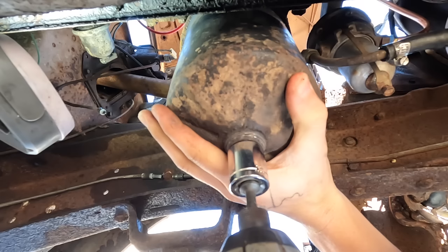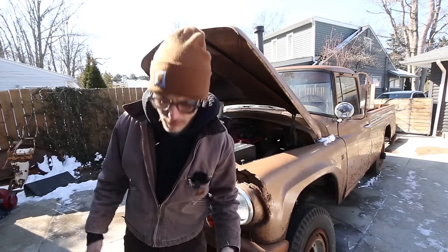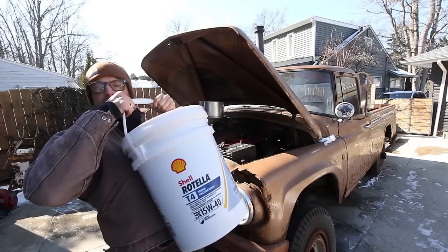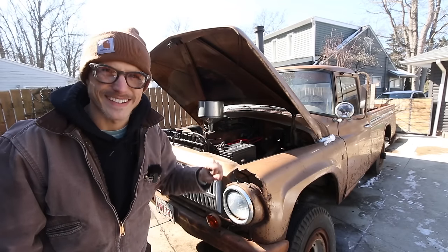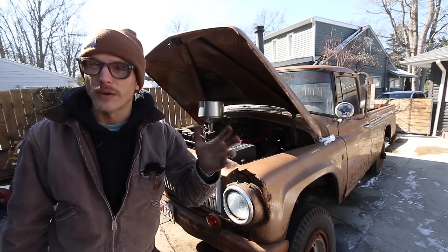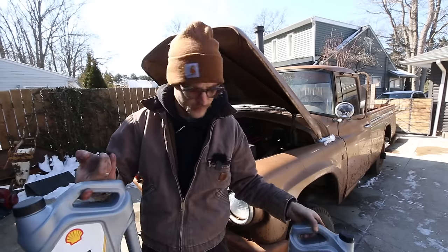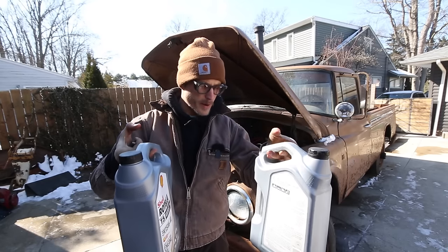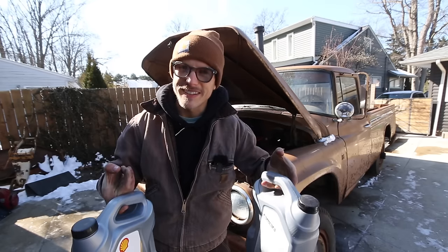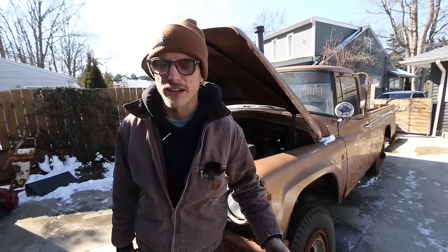Then we'll move on to the brakes. Now with the filter on, we're good to fill this up. We're going to be using the classic Rotella T4 — for all your rotten projects. These BG241 engines take seven quarts including the filter. I have these one-gallon jugs left over from a previous oil change — about a gallon and a half. I'm going to dump these in, maybe a little from that five-gallon jug, then start her up, let it drain to the bottom, check it, and go from there.